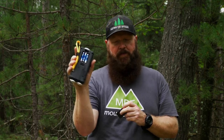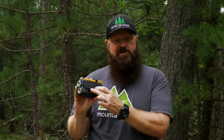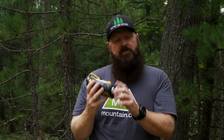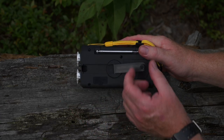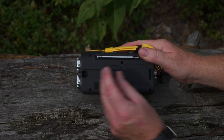There are four ways to get this thing working. The most conventional way is three AAA batteries, which go in the back as a backup. The three other ways are the most interesting to me. You can charge it via computer, any kind of charging block through a wall socket, or any kind of battery bank. Second interesting way would be the small solar panel on the top — as long as it's outside and there's sun. The most interesting way to me is the hand crank. One minute of hand cranking at about 120 RPM will provide five to seven minutes of flashlight time and about three to five minutes of radio time.